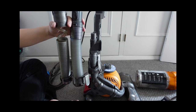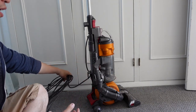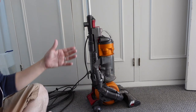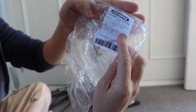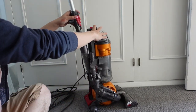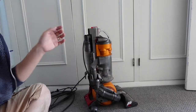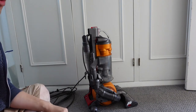I've actually replaced this before with a third-party hose and you just have to be aware that the DC24 actually comes in a few varieties and sometimes you're going to get the wrong hose. For example, I've installed the compatible Dyson DC24 steel hose, however this does not actually work correctly. Similarly, when you try to attach the hose, it's not going to click in correctly and that's because this is a different version of the DC24. So make sure you get the correct one.